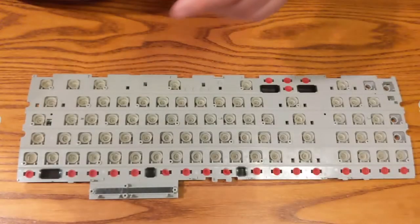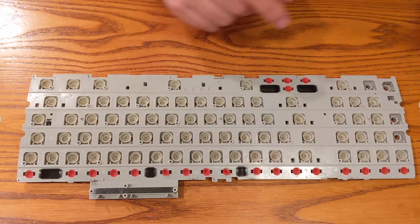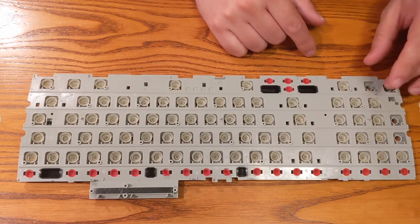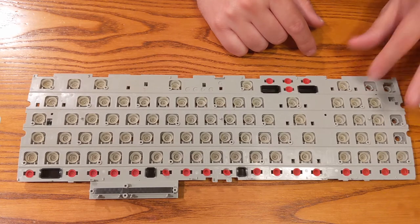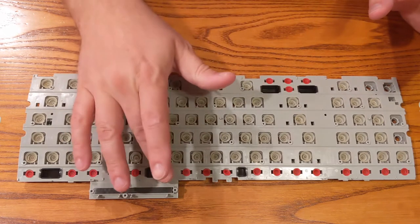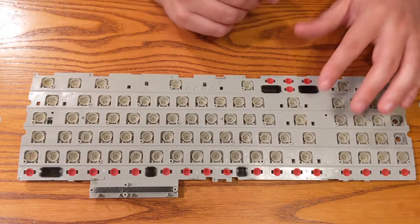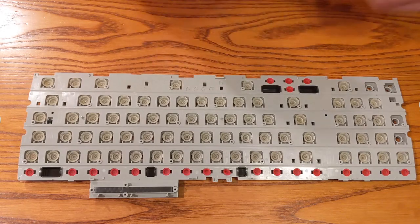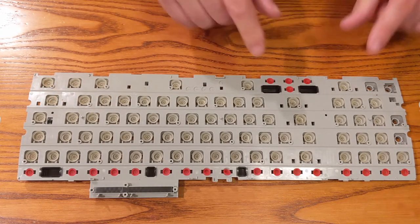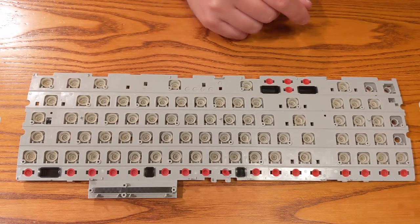But what I'm going to do, instead of just putting them back on the piece that, so here are the keys that were messed up. This is, you know, like the enter key and a plus key and the period key, which are keys that I might not use all the time, but I'll use somewhat some of the time. But there's a few keys on the keyboard that I feel like I just rarely, if ever, use. And so I'm going to move some good domes from those over to these more frequently used keys.